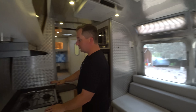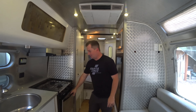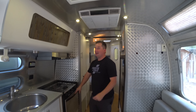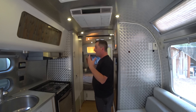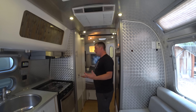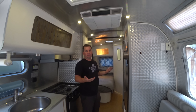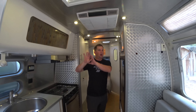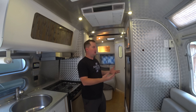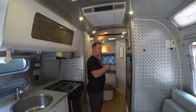Avoid super cold climates when possible, but when it's time to heat up, there are two ways to do it. You're never supposed to use your cooktop as a heater, but we'd be lying if we said we didn't leave the oven open every now and then after baking — it heats up the trailer quickly. The other way is to use the built-in heater. It's a really simple system that runs off 12-volt power. To run the heater you don't need to be plugged into a pedestal — you could be in the middle of nowhere or a Walmart parking lot — provided you have the propane and battery power to run it.